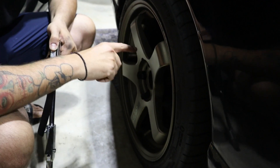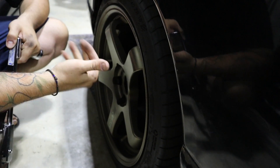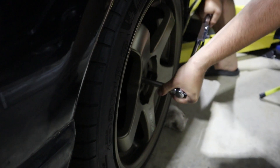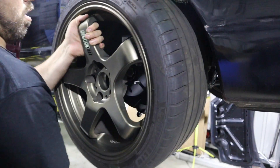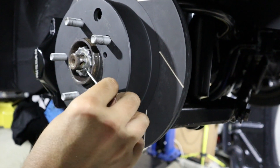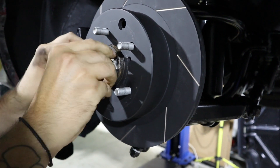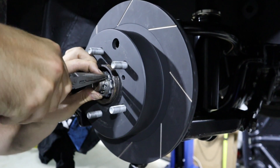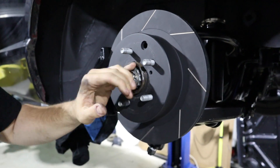Because we're going to torque it down to 270, if it's on the hoist it'll just keep spinning. So we put the wheels back on and took the center caps out. We'll get the torque wrench on it just to get it down to 270, then pop the wheels back off, put the crown cap on, split pin, and then we're done. The castle nut cap just goes on top — make sure the gaps line up with the holes. Slide the split pin through; you can use pliers or your hands, whatever's easier. That's not going anywhere — we'll go to the other side.